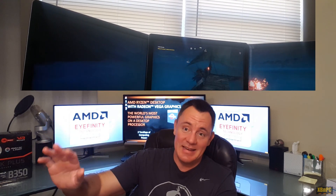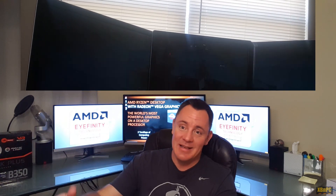Not only for gaming but in applications too. He didn't have fast startup turned on — I like to keep that turned off because it's almost like sleep mode where it keeps some files in a page file or swap memory, and it can cause problems with Windows updates. So I kept those turned off for him. And even so, even on a SATA-based SSD — not an NVMe M.2 SSD — his system still booted up in like 10 seconds literally, from pressing the power button through the BIOS screen and into Windows. Really, really impressed with these chips.